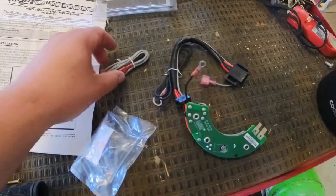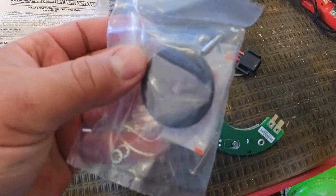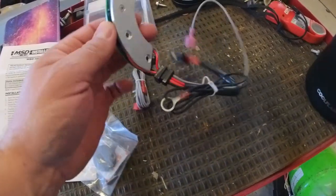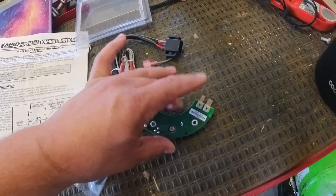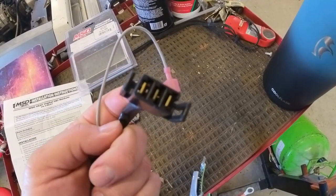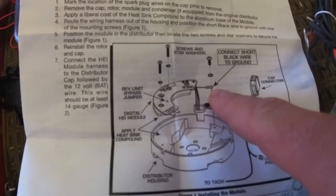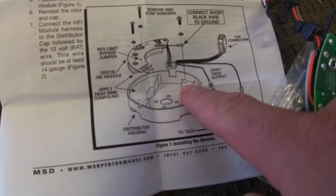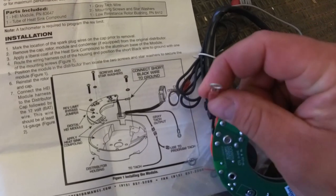So what's in the box? You've got the module, a wire that can be operated as a jumper to the tachometer, and a small bag of parts which includes nuts, bolts, screws, the low-resistance distributor rotor bushing, and some thermal compound. That's to help dissipate heat — it gets spread along the bottom surface that sits in the distributor. You connect to the mag pickup here. On the output side you've got a big ground wire that can go to just about anything, and the normal connector that goes to the distributor cap. Per the instructions, the small black wire gets bolted down where the little condenser/capacitor canister was — I believe it also helps with grounding.